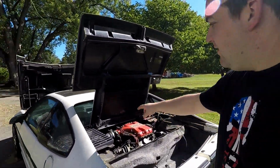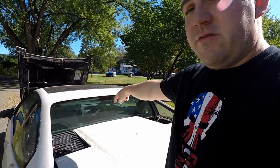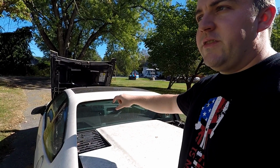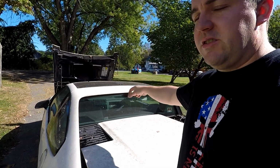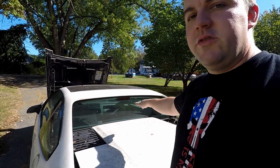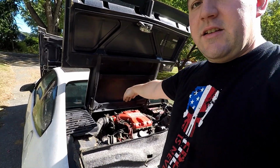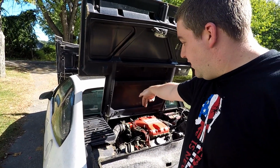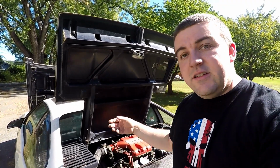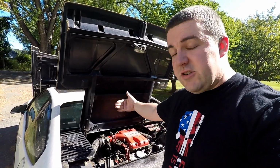The engine on these, behind the engine, in front of the engine, behind the rear window, leaves can get in there. Originally on the cars, there was a piece of rubber there to stop things from getting down in there, but they found that could cause some issues, so they removed it on the later models, so there is no seal there. So leaves can get down in there, and then they land on the rear exhaust manifold, and if you're just sitting still, they can light on fire, the leaves, and then cause issues. So you basically want to make sure you clean out any leaves.